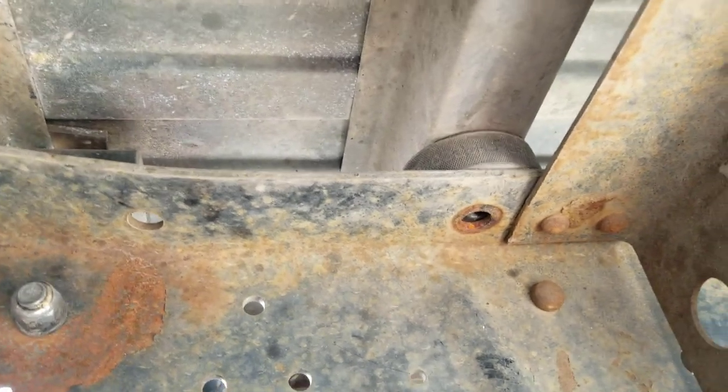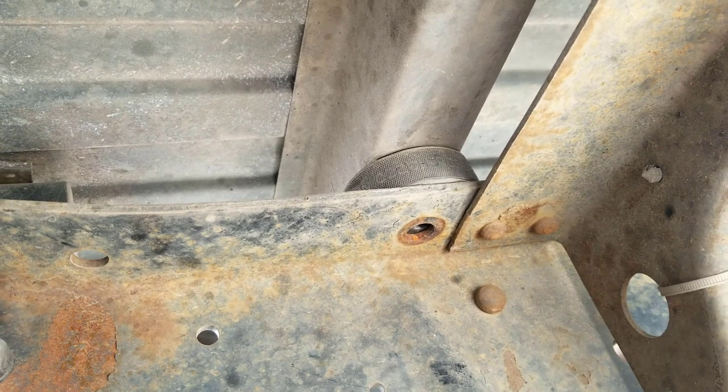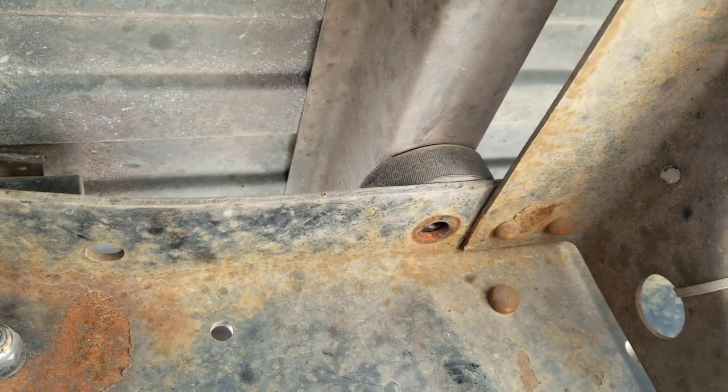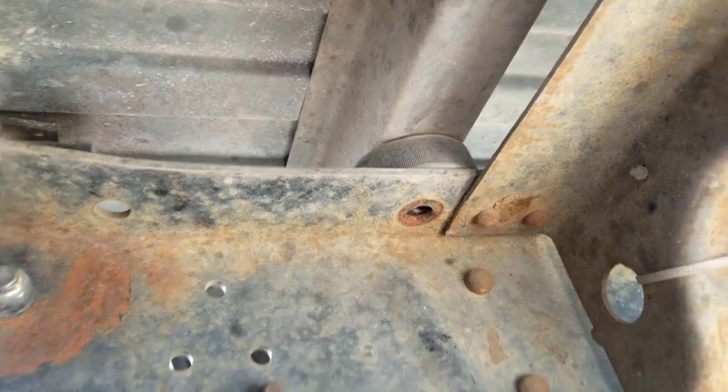The bushings under the cab and the core support are the correct body mounts, but there is also the spacer with the hockey puck as well. So we'll be able to ditch all the hockey pucks and get the correct poly bushings in there. So that'll be really nice.